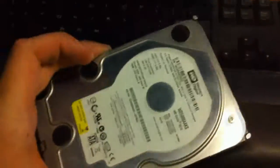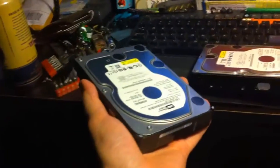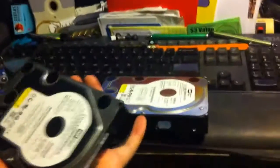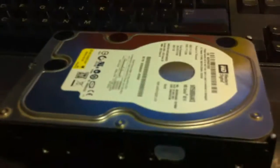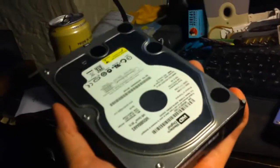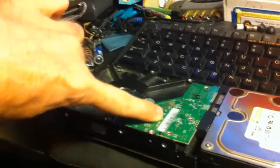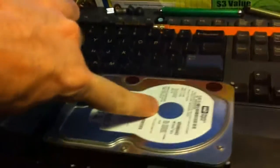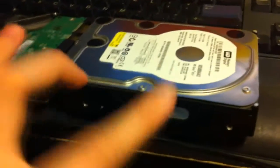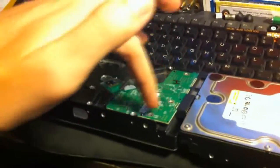This is the dead drive that just died recently. I know that this drive is the exact same model as the one that died a couple years ago. So I thought maybe the circuit board died on the drive that just died, and the actual disk or heads died on the old drive. If I'm lucky, I can swap the circuit boards from the two-year-old drive to the recent drive, and probably have to recover the partitions.